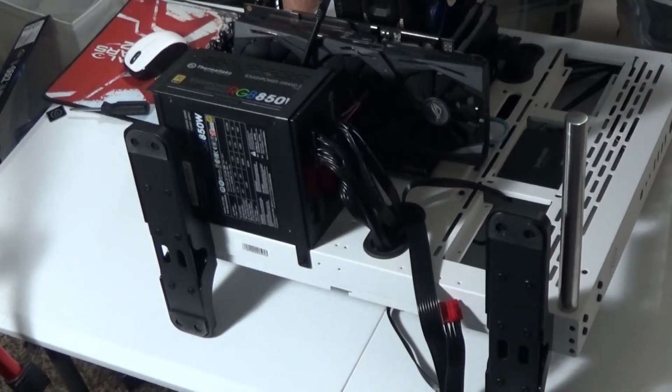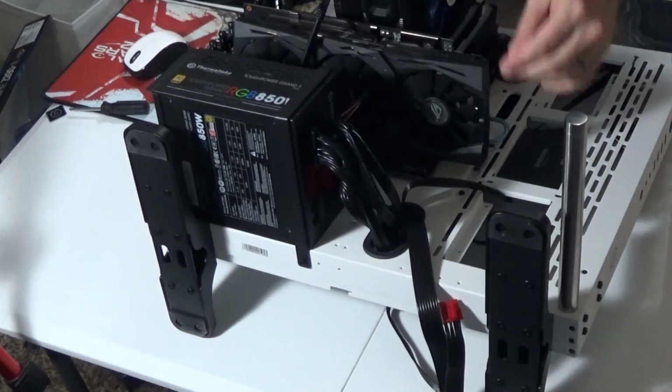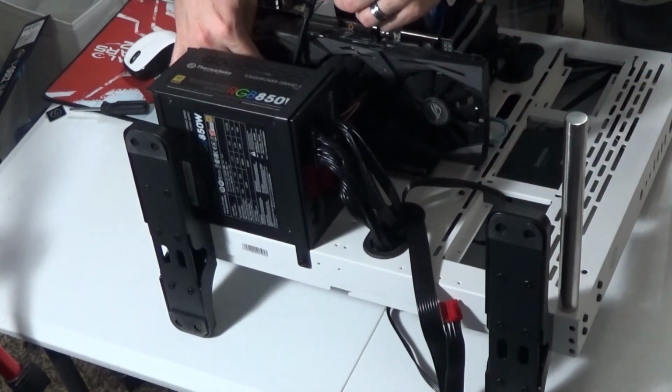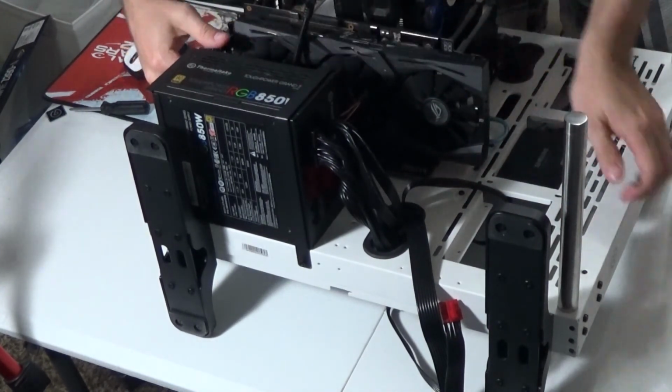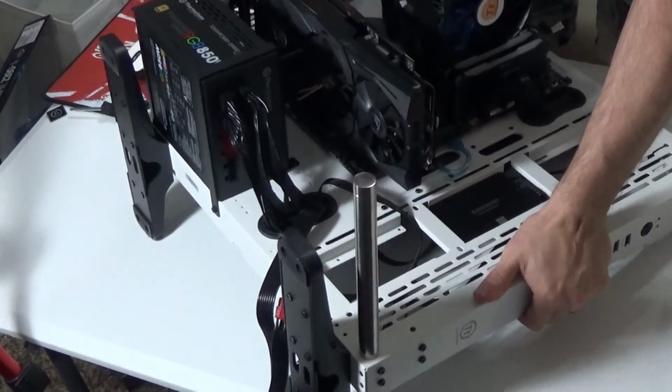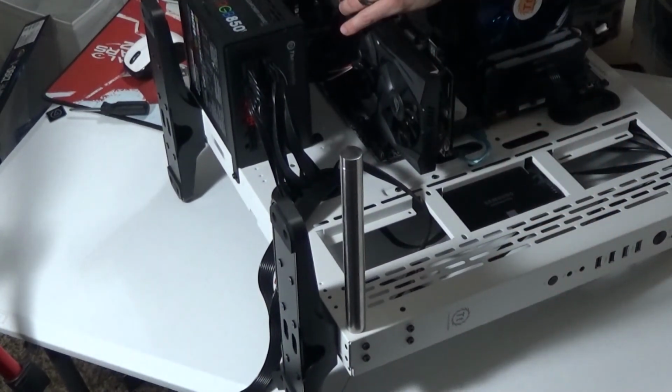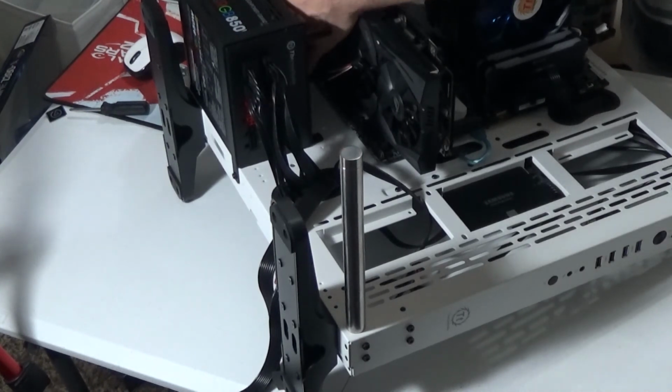Just plug them into the ports that are at the bottom with the respective names. Look for USB, look for U3 1G1. That's gonna be your 3.0. And other than that, everything should hook up. So I'm gonna go ahead and hook that up now on my side. It might be a little hard to see. I'm not sure if the camera's gonna pick it up or not from this angle. So AAFP is going with the audio. I just need to sync it up right here.